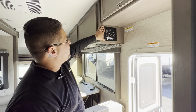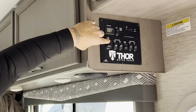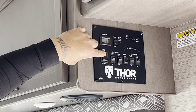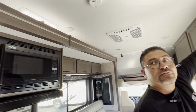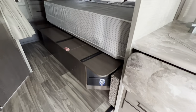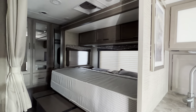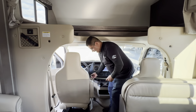The slide extend button is located at the control panel by the entry door. Make sure nobody is sitting on the slide while pushing it out. Hold down the slide extend button and hold it until the wall stops by itself. Once the wall is fully extended, go ahead and turn the vehicle off and take the keys out of the ignition. Electrical, sewer, and water were the first hookup steps; next were the stabilizing jacks; then the slide out — now everything is complete.